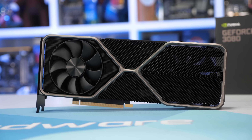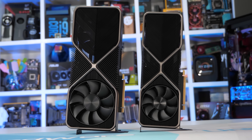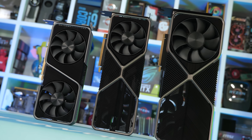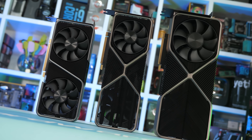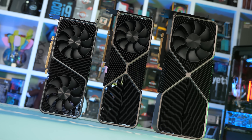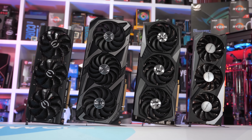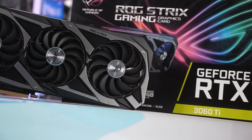Since the release of the 3080, NVIDIA also sped out a fully unlocked version of the GA102 silicon called the RTX 3090, costing $1,500 US — which made no sense whatsoever, as I said in my day-one review. After that we got the RTX 3070, based on the smaller GA104 die. At almost 40% smaller, it's possible for Nvidia to get many more dies out of a single wafer, and supply has been slightly better but ultimately still quite terrible. Also sharing the GA104 die is the RTX 3060 Ti — probably the hardest to find of all the Ampere-based GPUs.